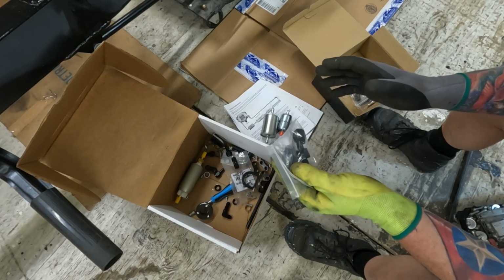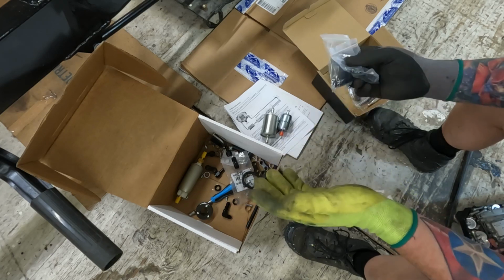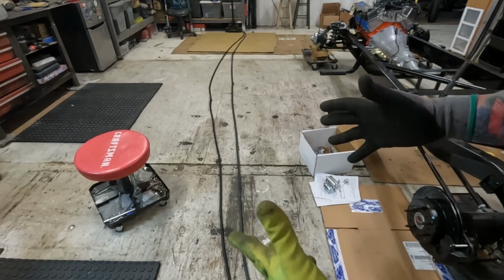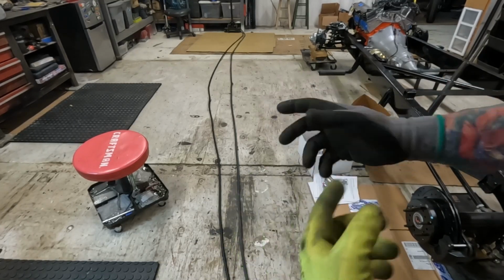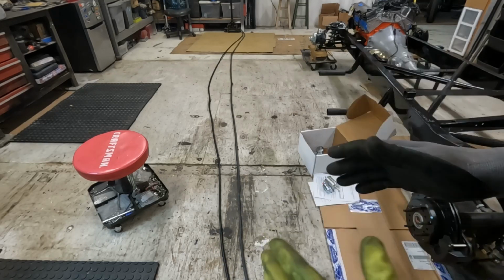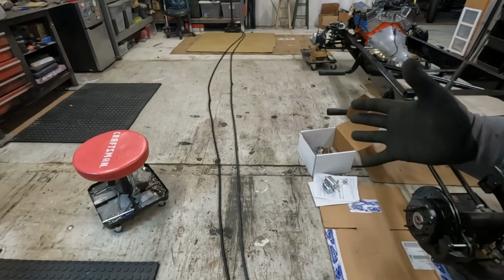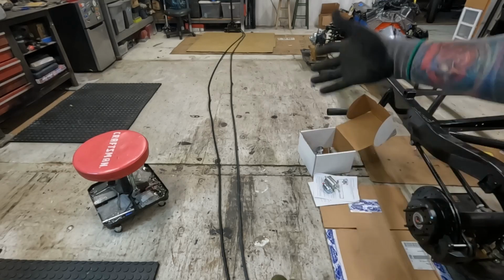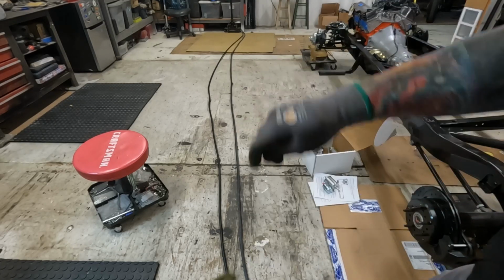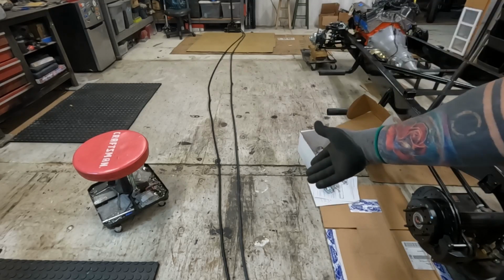The Holley Sniper, the fittings on the power steering pump and inside the transmission are all 6AN or -6. So quick trick, your hose is going to come all zip tied together in a circle. I'm fortunate. I live in Texas, the hottest place on earth right now. So just take it outside, throw it in the sun for a couple of minutes down here, heats up that hose, and then you can lay it out straight. That way you don't have to have all those funky bends and worry about and try to keep going straight. It'll just be straight. So in the sun, heat it up, then lay it out in the shop straight.